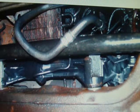Underneath the vehicle, you look, and here it's sitting. That's your sway bar there. This here is the transmission cooler on this particular vehicle, and the transmission hose for the cooler is flopped over it. This here is just part of your frame, and sitting right in there is this strange looking thing, and that is your steering rack, and there's little tubes that run on it. These are the brackets for the bushings that I told you about on the previous picture.